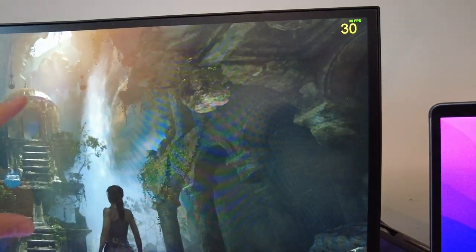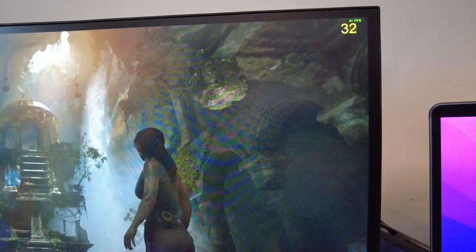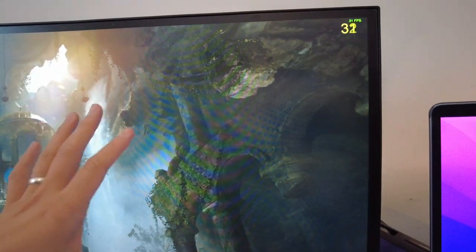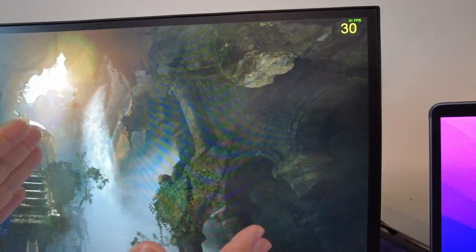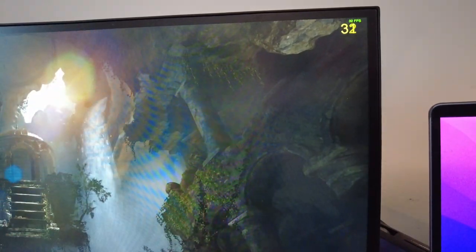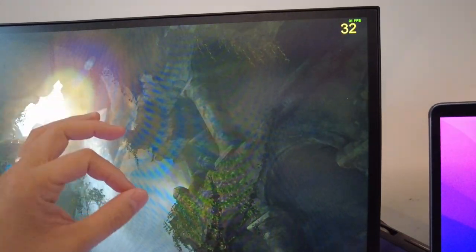So this particular monitor is a little bit old. This is a 2015 kind of ultra-wide monitor. If you were using something like a FreeSync monitor with 144 Hertz, then you'd see a lot of benefit from it. If you have a really big FreeSync range, say 30 frames per second onwards, then you will see really nice fluid motion kind of all the way through. Even if you're running games at really high settings, it will feel a lot smoother, especially with Adaptive Sync turned on.